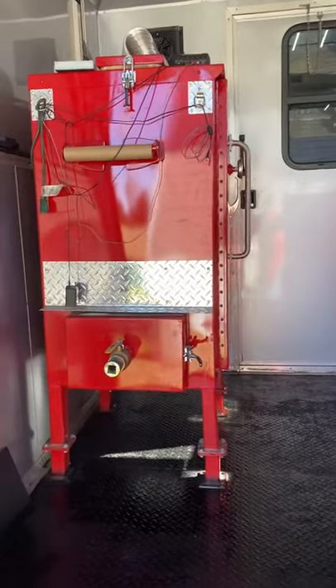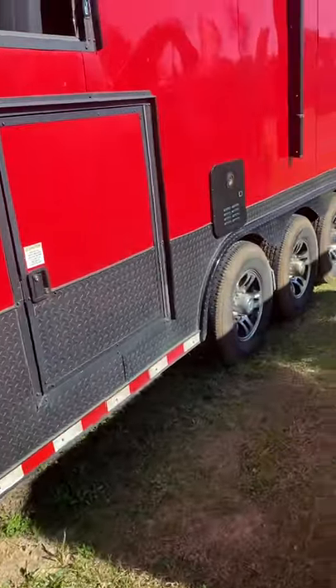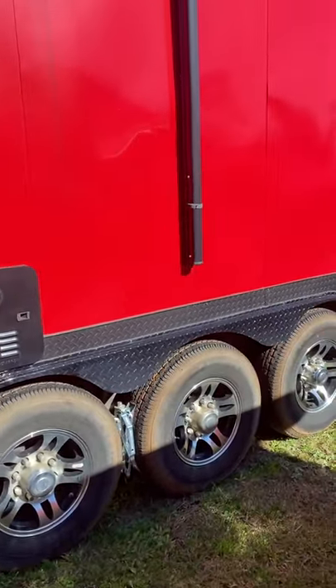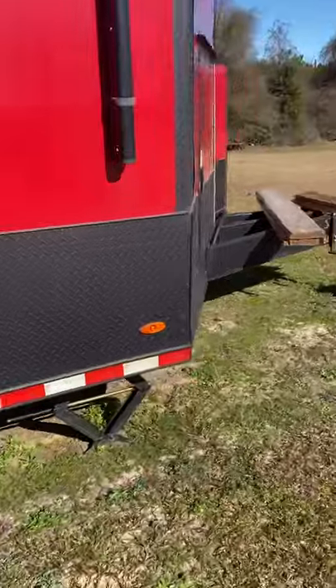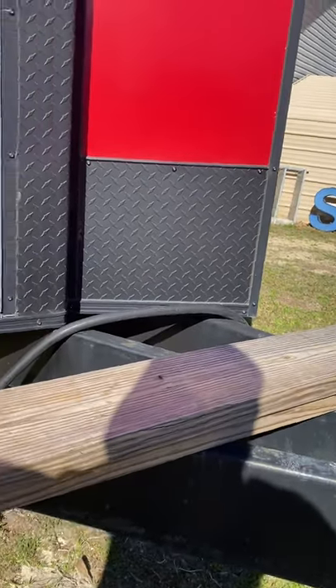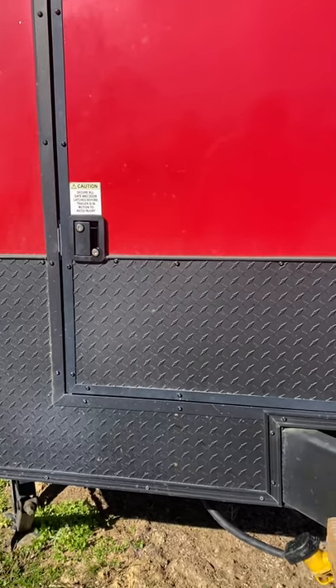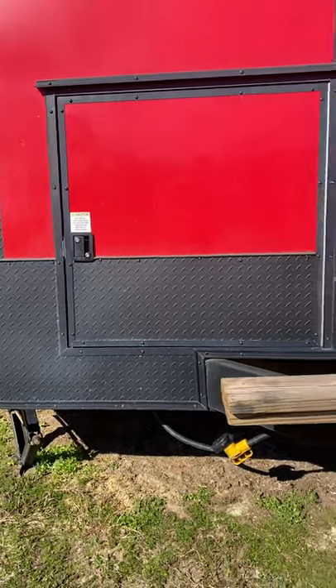I do that about once every six months to a year. One thing unique about my trailer: in my design, when I had it built, I had them use eight-inch tube steel — most trailers are made with six. All the way from the front axle all the way back is doubled eight-inch tube on 16 and 24-inch centers. You'll never have any sag with this trailer the way it's built. Yes, it's heavy, but that's the reason we've got the triple axle. It pulls like a top on my F-250. The two outside pieces that go down are doubled from basically right there at the door all the way back for great support. I run about 75–78 miles per hour on the F-250 and I literally do not know it's there — it tows awesome.